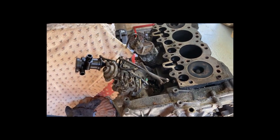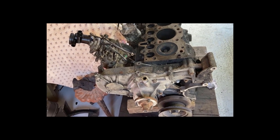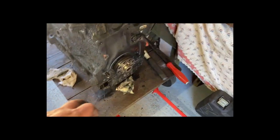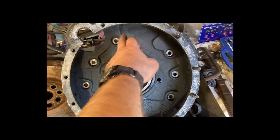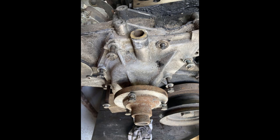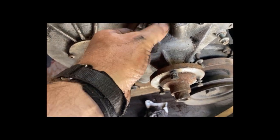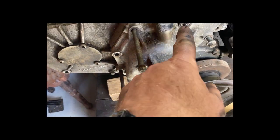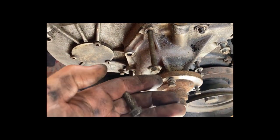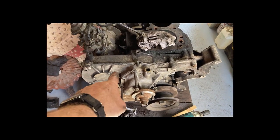Need to get the high pressure pump off - there's still a bit of coolant knocking about in it. I've got to make up a frame to carry the engine, basically picking off the hole markings to make an adapter plate for the front of an engine stand, so I can get it up off the floor and start looking at it properly. There's an assortment of fixings on this end - some odd-ball bolts: a 12mm head, some 10mm, and a 13mm. Maybe they've been lost and replaced with whatever was to hand. Anyway, water pump next, then we'll look at the casing behind it and the timing for the pump.